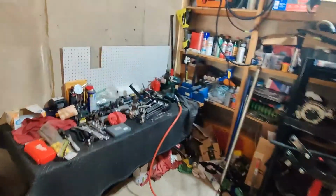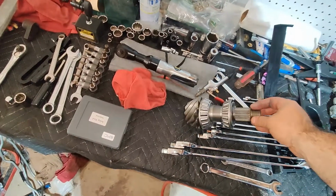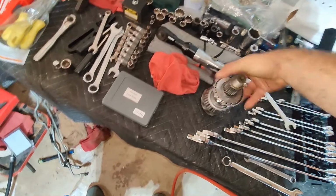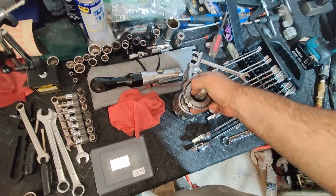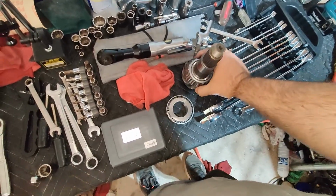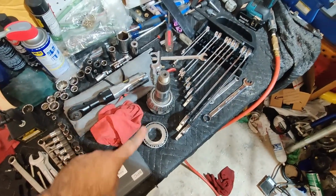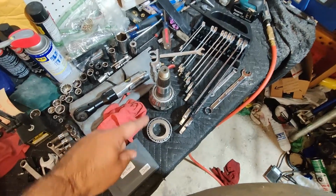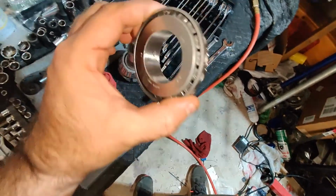But yeah, I've been pretty much ready. As you can see here, this is the 410 pinion. I've made some setup bearings. For those that don't know about doing the re-gear, typically these bearings are pressed on. These are the exact same bearings that I'm putting in for the final assembly. Since they're the exact same, I have these ones that I've actually honed out.